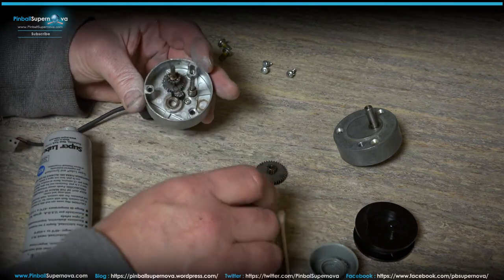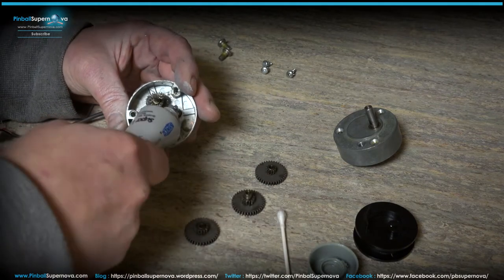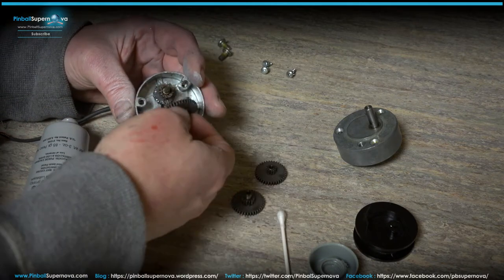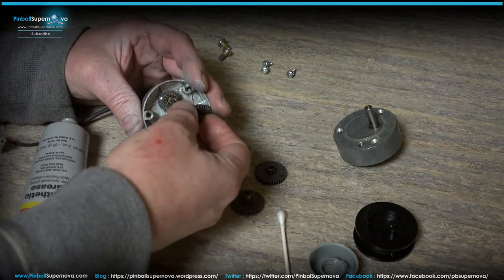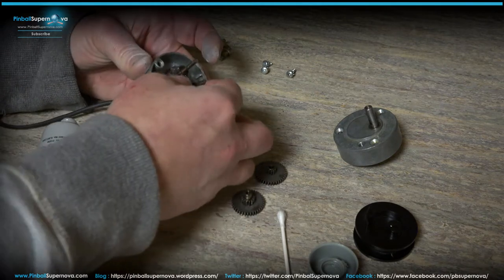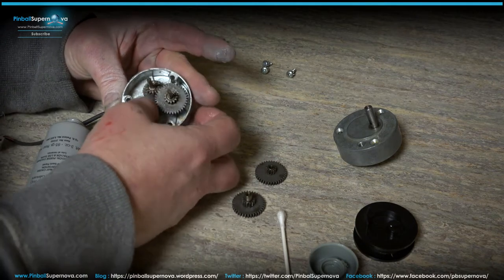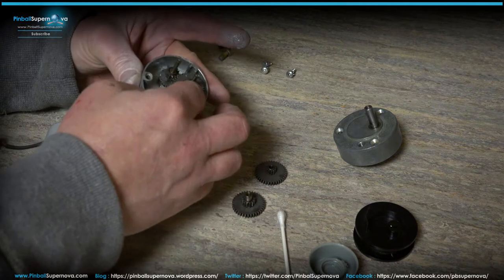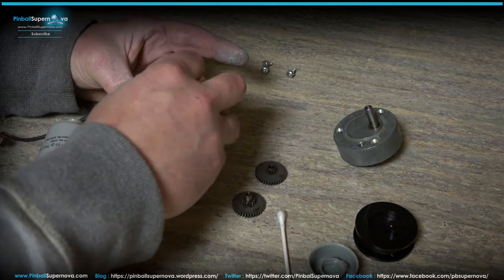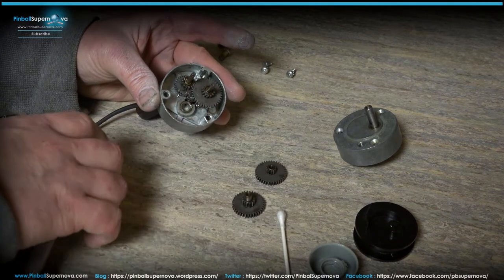And then you want to put your second gear in there. So you might want to put a little bit on the shaft and slide it, situate it around there, just get it in there. It gets a little messy, but you have to do this to get everything to work, so everything moves and slides well and soaks into all the metal pieces and the gears again.